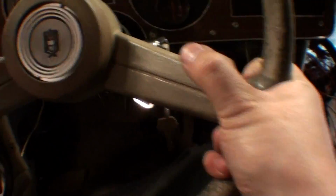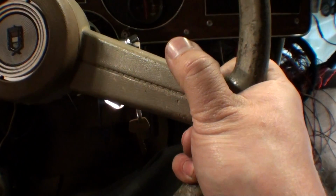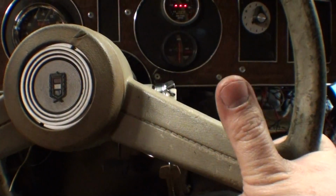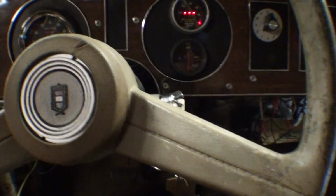So you can't accidentally. What'll be neat is when you have it on a button, you trans brake on this side, and you first bulb stage, trans brake, and then you come over here to your bump button, and you hit it, and nothing happens, and you let it go, and it bumps. Then the car lurches in. So it's only when you let go. So what's kind of nice is the car isn't going to lurch, and you're not going to auto fire it into the second beam.